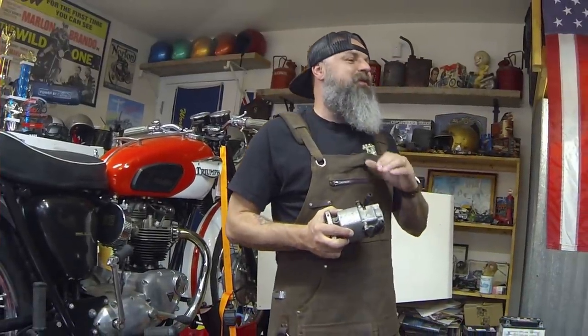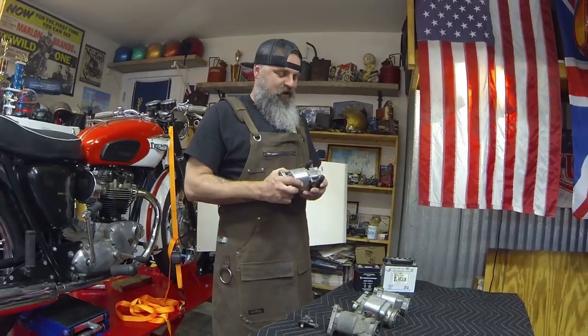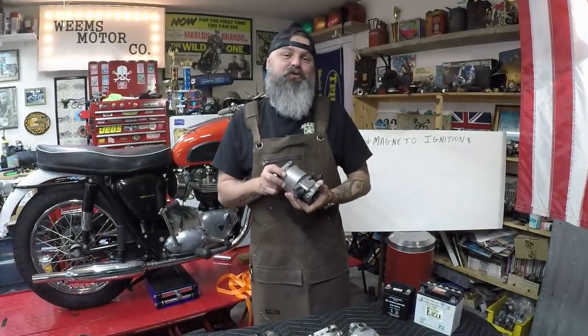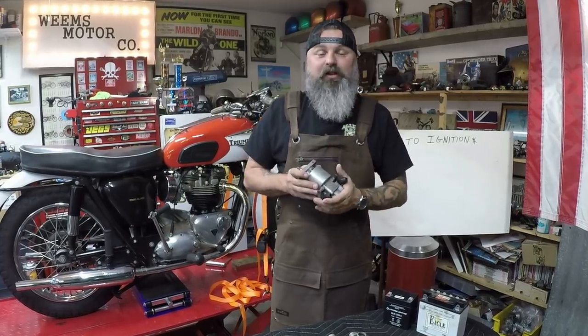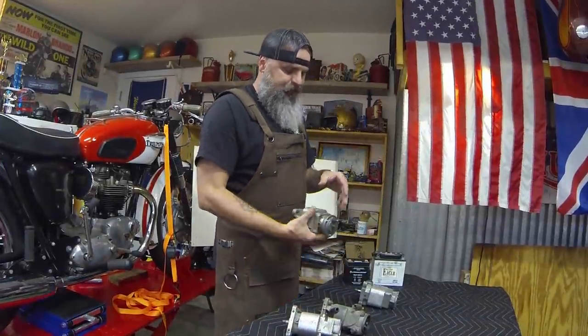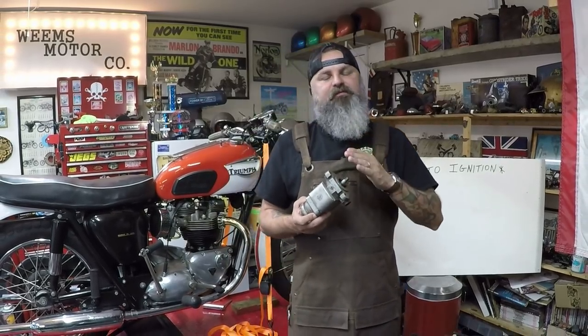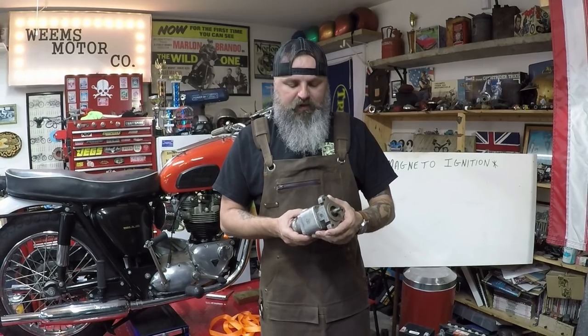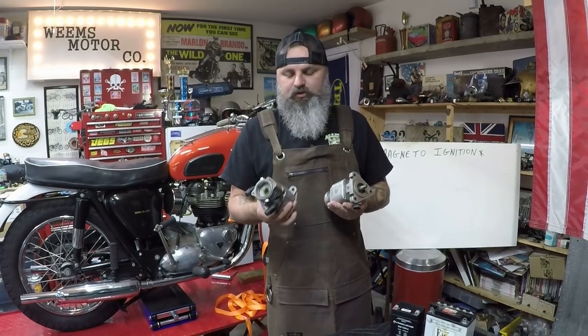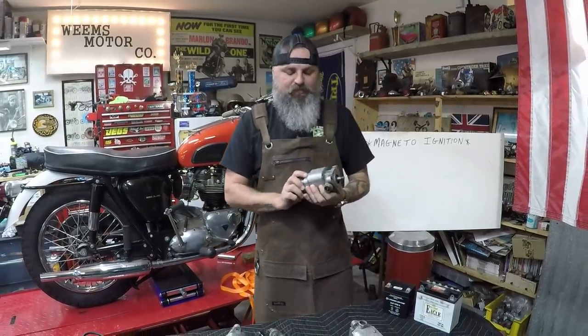They were not known as the most reliable electronic systems out there. However, they did a really good job for what they are. Lucas was the main manufacturer for a majority of the components in the electrical systems of pre-unit Triumphs. There was another company, however, that built a magneto, and that company was called BTH. You would find the BTH magnetos on a lot of the earlier models, say 1952 and earlier, because Lucas at that time had not really designed a great component for the pre-unit Triumphs yet. So the Triumphs were using the BTH magneto.